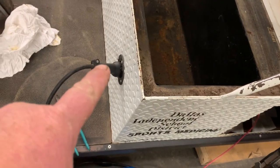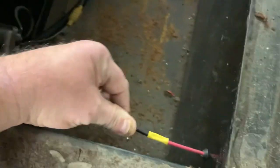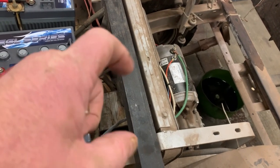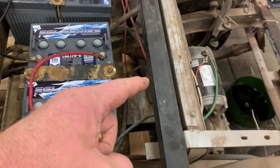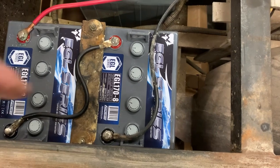However, to use a battery charger that has its own little brain, you have to cut the wire from the port here, and then we're going to make a charge wire through a grommet here, and we're going to go to the battery straight to the negative. So basically this little brain switches the negative on and off for the other style battery. So this is not going to be used anymore, so we're just going straight to the battery with a negative sensor wire.